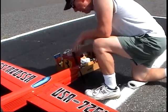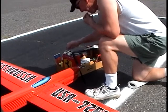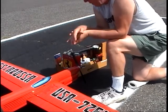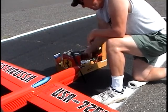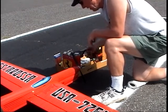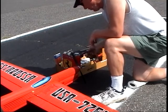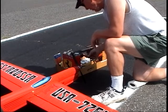I always thought that, in my case, the heat would hurt other people a lot quicker than it hurt me, because I do a lot of work outside. But this summer, between all the rain, some of the things we've learned is, in this season, we've made what I think are some upgrades. This fueling system that Rich Oliver has, where we can meter the fuel, and I can back out 3 turns, 4 turns, whatever amount I need, that system is bulletproof. And you almost never get the wrong amount of fuel in there. In fact, I haven't once had it shut off prematurely or run more than about 10 or 12 laps. Because once I find out where I am, I can pull out 2 or 3, and that's been an upgrade.